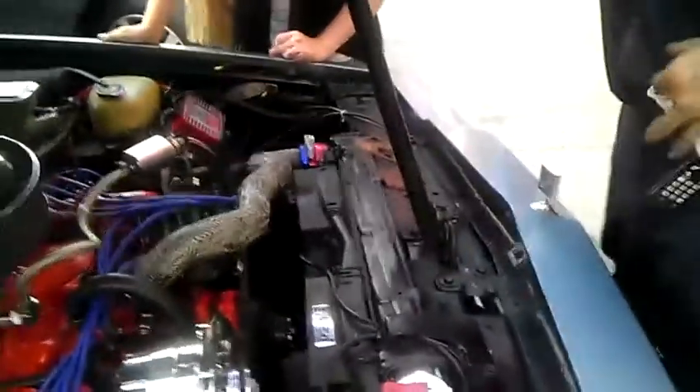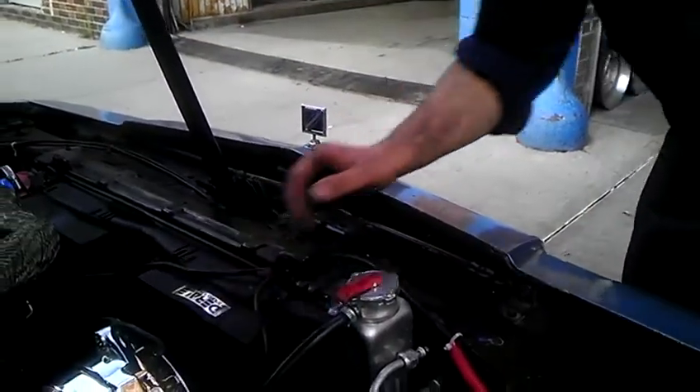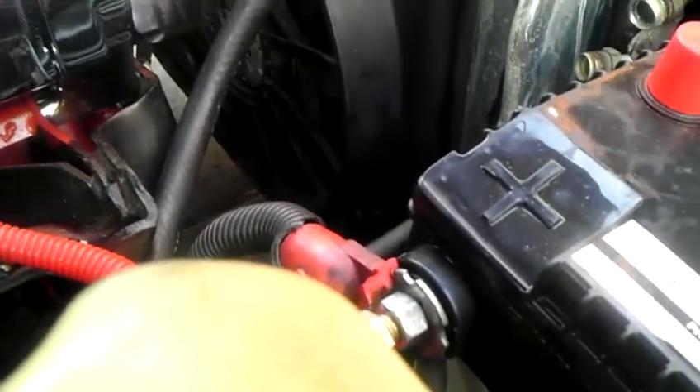Is this an issue with the way they come? They don't come off now. The issue is you might want to get one big fan. What's happening is the two fans you have, they're not covering the whole radiator. It's like half — believe it or not. The bottom — you have more on the bottom. You have like some area there still, like three inches, probably a little more. It's not cooling the whole radiator.